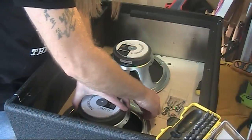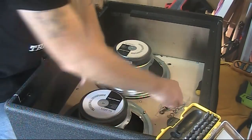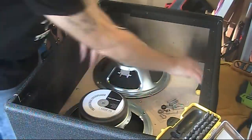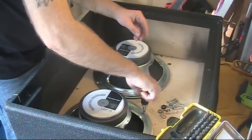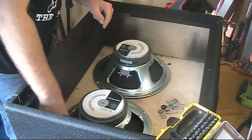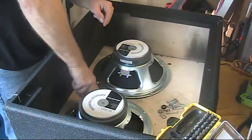I'm probably overemphasizing this a little bit, but you can make a speaker sound really rubbish if it starts rubbing because you've over-tightened the speaker in the cabinet. What I do is start one screw just very lightly, then move diagonally across to the opposite screw, then the next, then its opposite — like this. So not clockwise — tighten it opposite each other. Tighten one screw, then the opposite screw, move to the next, tighten that and the opposite. That way you get them uniform.